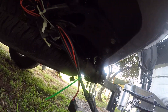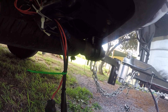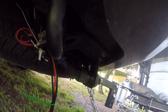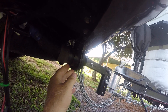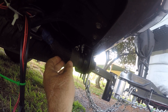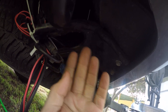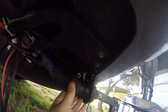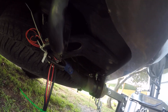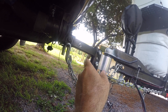Hopefully this is helpful. I found this on a video, but I did an earlier video myself on the Toyota 4Runner — how you reroute the trailer connector to a point where you could use it and didn't have to crawl on your head. When you buy a 4Runner, your trailer plug outlet is mounted up here in this bracket, and you've got to crawl under this thing every time to get to it. In my first video, I actually left it in the original manufacturer location and ran a pigtail out. I made a plate out here so I could plug it in there.